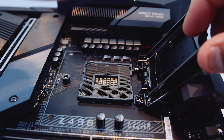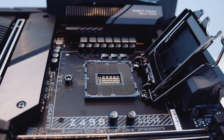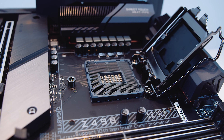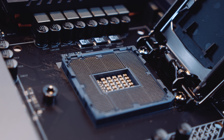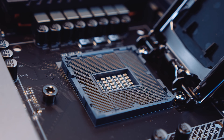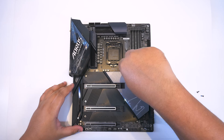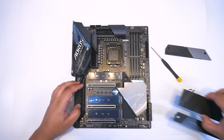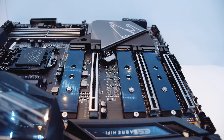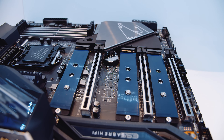Let's pop that socket open and have a look at the brand new LGA 1200 socket. It's not electronically compatible with older sockets, but the cooler mounting is the same as the 115x sockets, which is quite nice — so if you're upgrading to this platform you can use your existing Intel cooler. If we look inside the socket itself, you'll notice the locating tabs are at the bottom, not at the top like the old 115x chips. Let's pull off all the heatsinks and take a look at the M.2 layout — there are three M.2 slots, all towards the right-hand side of the board and covered by a massive array of heatsinks.